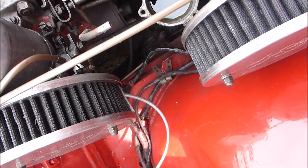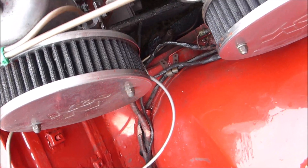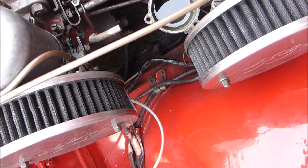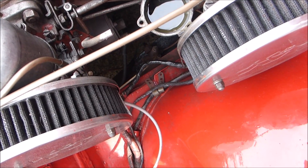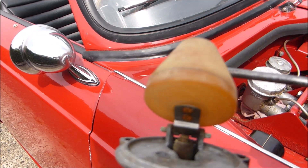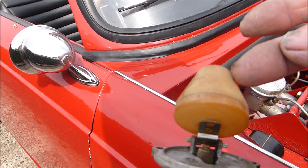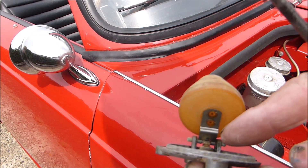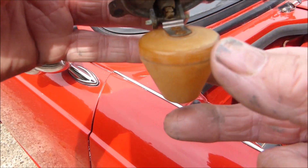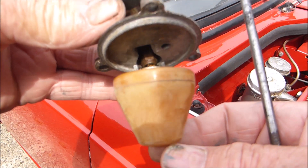You can see there's fuel in the fuel chamber and it's not full to the top. Sometimes if the valve is sticking, it will come right up and overflow, so the valve is actually doing its job. But I'm afraid it might be sticking rather than not getting enough fuel in. This chamber — when the fuel rises it pushes that up and closes this valve, and gravity allows it to come down. You can see it working like that, but sometimes they do stick.